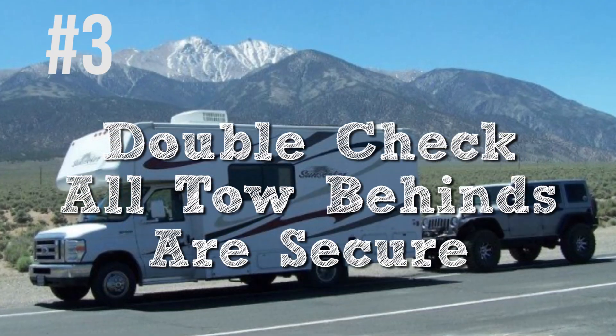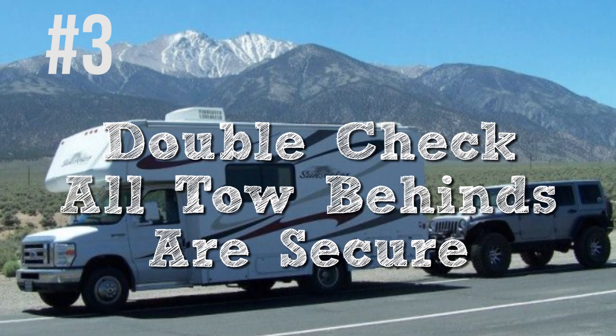Number three is make sure that your trailers or tow-behinds are secure. You want to make sure that your tow-behind is connected properly to your hitch — make sure that the cup is set securely over the ball, you're locked in place, and you've got your hitch pin through the connecting hole. Always check and make sure this is secure — check three times, and every time you stop, make sure you check again because it can bounce out if jostled. The last thing you want is to look in your rearview mirror and see your fifth wheel bouncing back down the mountain.